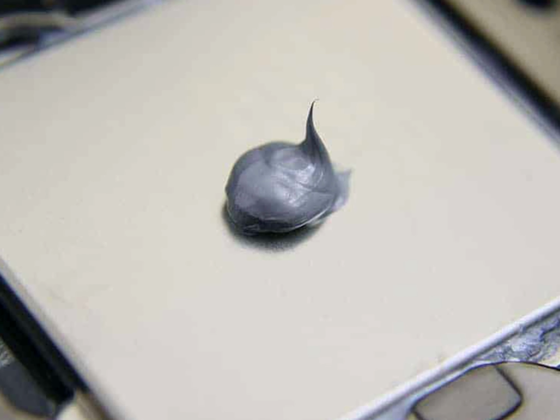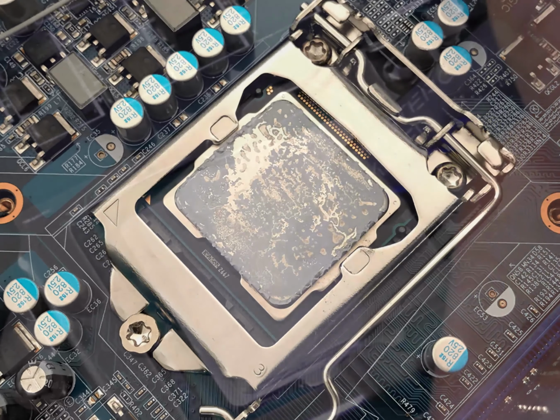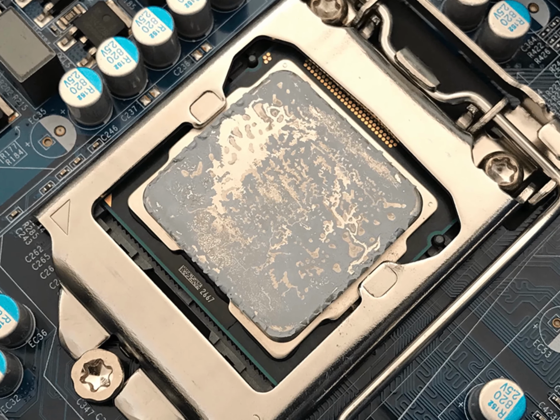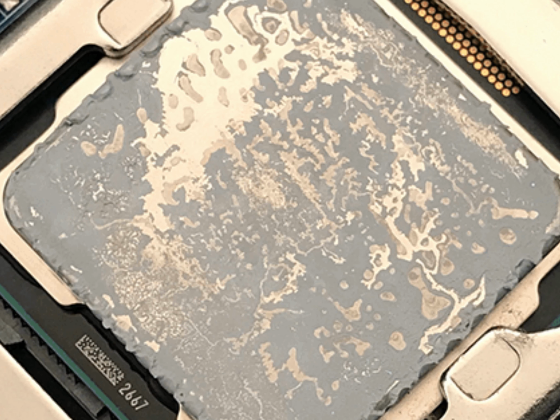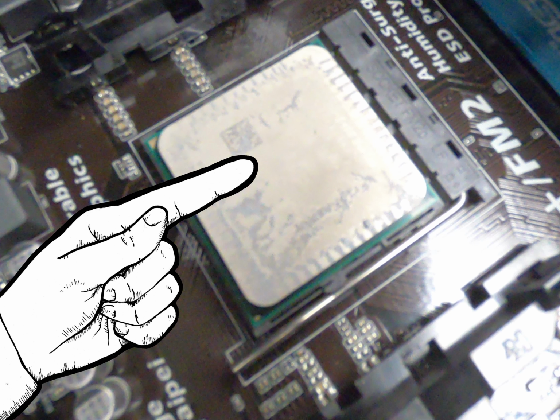And now, the moment you've probably been waiting for, or not, now comes the part where we show you how to change the thermal paste. When you take the CPU heatsink off of the CPU, you will see that there is some stuff on the CPU. That is the thermal paste. If you are still going to use the same CPU, that stuff needs to come off first.